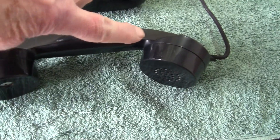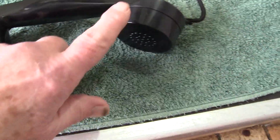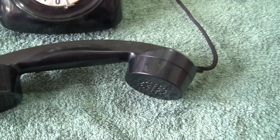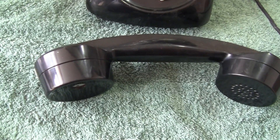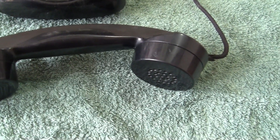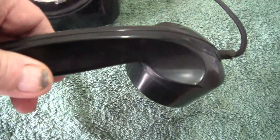This one has got the standard type of handset arrangement with two screw-on caps — transmitter and receiver. Without taking it off, the receiver is the rocking armature type, the same type you would find in a 706. The microphone part is the good old top-hat type, which was a well-proven and quite successful design. That's the handset — a futuristic shape but very, very light.